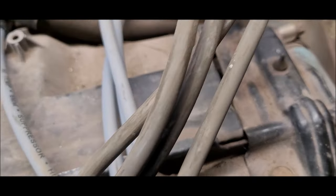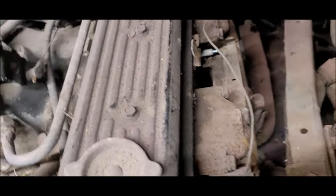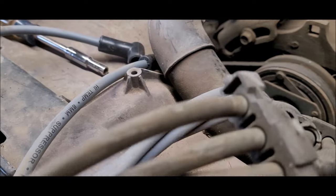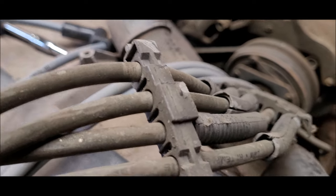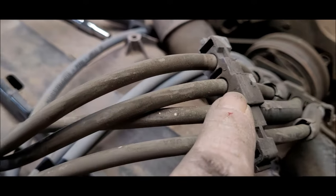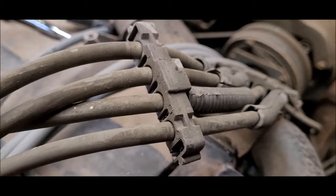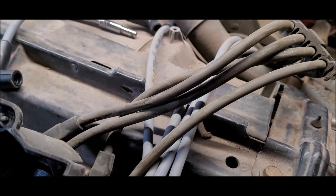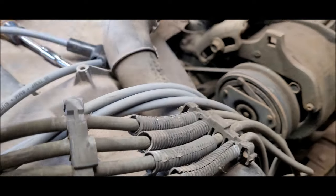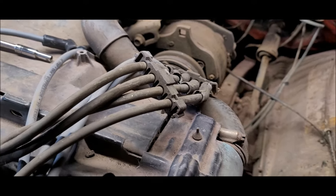I'm not sure if the wires have been changed before or not. It kind of looks like they have because they weren't on the posts correctly — the wire loom portions of them. So I think they were put on or changed, but whoever put these pieces on didn't put them on quite right. I don't know that they were actually sitting on the exhaust manifolds. But we'll try to get them in there straight and put these little pieces on too — I think they help protect the wires on the backside of the engine where they could chafe.